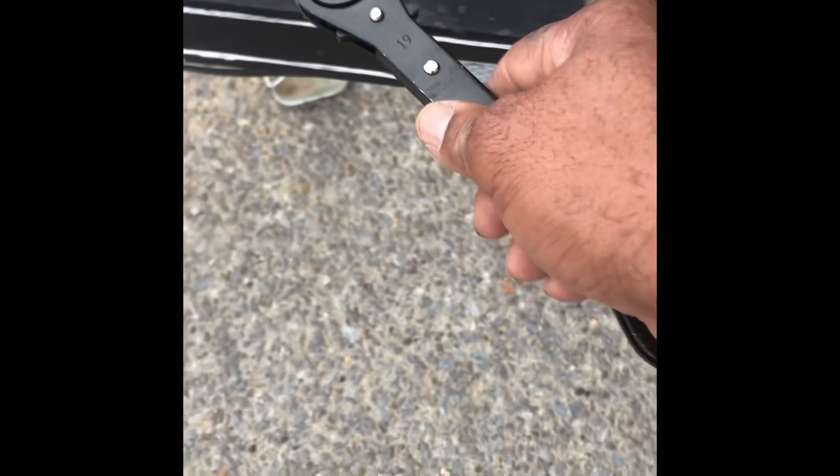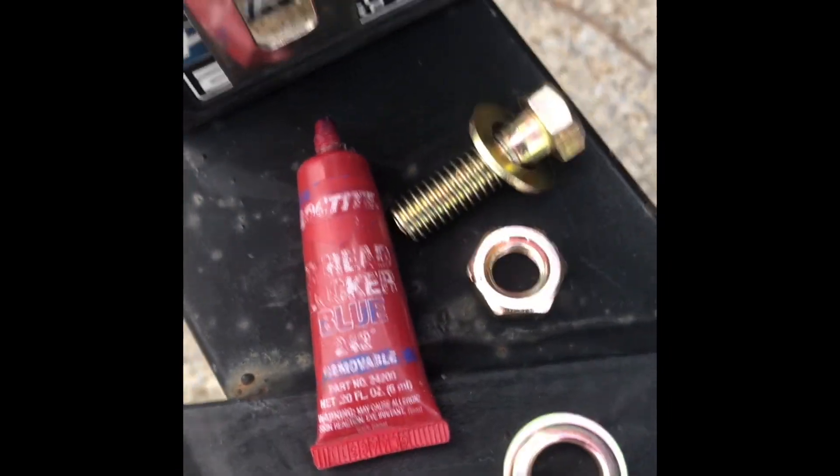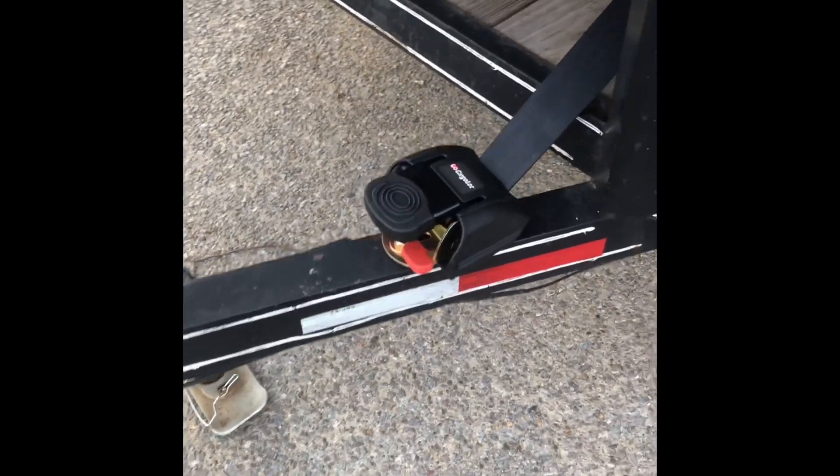And maybe if I was in a pinch or two until I find something better, those will work. I'm gonna put the other one in and show you the rest of the video. That nut's a 19, and the head of that bolt is 5/8, so you need a 19 and a 5/8 — or three-quarters and a 5/8. Even though it's got a lock washer on it, I'm using some of that red Loctite because I don't want it to back out. She's on there tight and snug, both on. That is a quick, awesome fix.